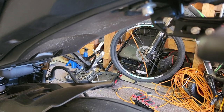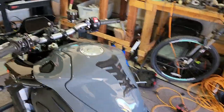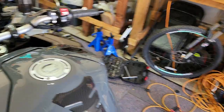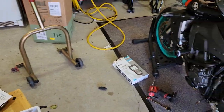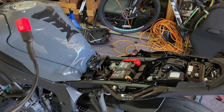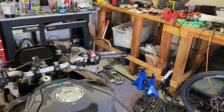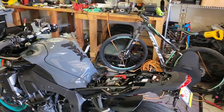If you do take the ECU out and send it off to get flashed instead of taking the bike somewhere, you're going to have a bunch of error codes you'll need to fix — you're going to need a scanner. Other people are using those handheld scanners and they work, but neither of them worked for me. I was freaking out because I've got a $16,000 paperweight — the dash would come on but it couldn't do anything, it would turn over but it wouldn't fire up. I had like 16 error codes in there. I ended up using this trusty little OBD Link LX that I've had for years for programming Triumphs and Aprilias with TuneECU. I plugged that into the harness and used the Torque Pro app — it's like $4.95 on the Google Play Store. It does cars and motorcycles, and I'm sure there's a version for iOS if you've got an iPhone.